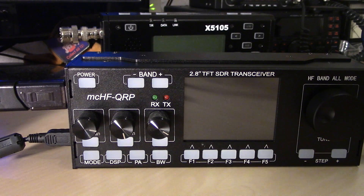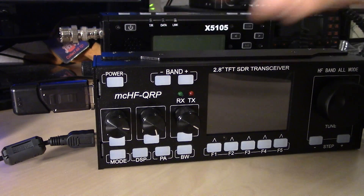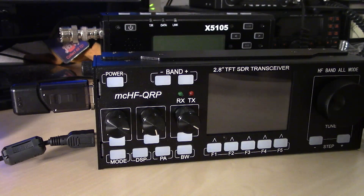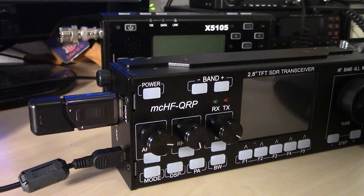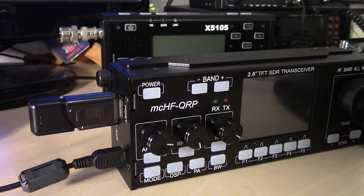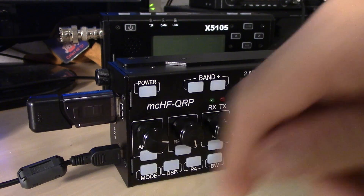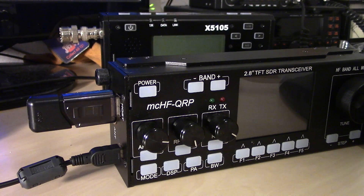The bootloader is now successfully installed. I have my USB drive in the host port — formatted FAT32, no exFAT or NTFS, just FAT32, nothing in the root except the firmware.BIN file. When you download the firmware there's a firmware.DFU for USB cable mode and a firmware.BIN for USB host. The bootloader needs to be on the device before you can upgrade firmware, and to flash the bootloader you use the cable. So: bootloader via USB cable, firmware via USB stick.